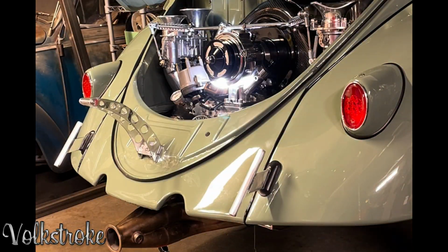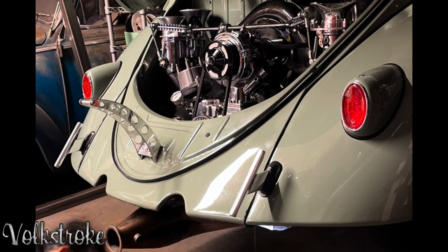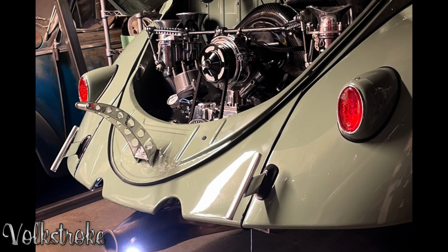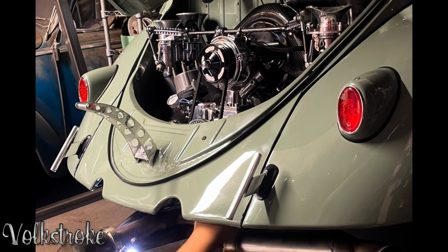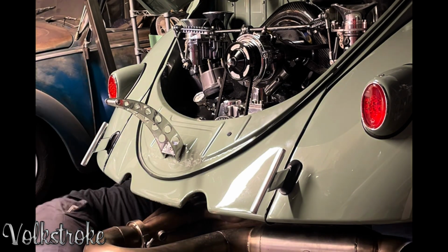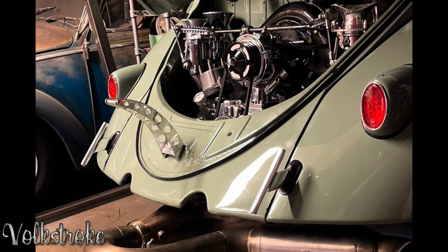You're gonna have to go through the gears in motion a few times with the car jacked up in the air and using your clutch, or just driving it around. And you might have to adjust your shifter, but most of the time you shouldn't have to adjust much. It's very minimal. And that's one good way to not ruin your transmission, because if you get it in and start shifting it right away without oil, without having all the gears meshing, you're gonna ruin it, especially if you have a synchro transmission.